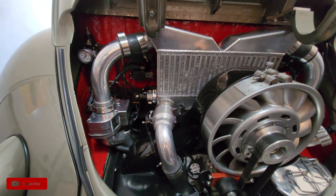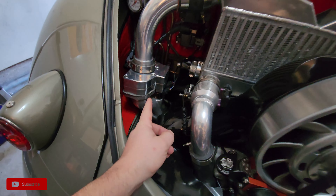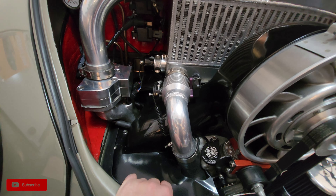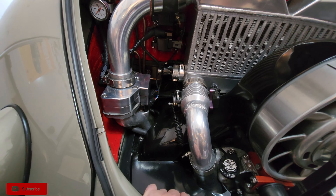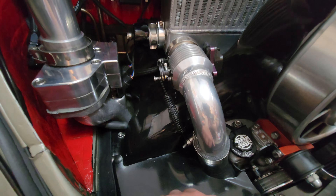I believe I may have toasted my rings, jacked them up one way or another. My baby Envy - I got a little excited when I first got her on the road, as I normally do with most things, because she had been sitting in the garage for well over a year. I finally got all this in here, got out there and got a little crazy before I had her tuned up. I may have had some pinging issue in my cylinders - too much fuel, not enough fuel - and once the turbo starts to come into play and you don't have your fuel tables correct, you get some pinging, pre-detonation, and it can destroy your rings or jack them up.